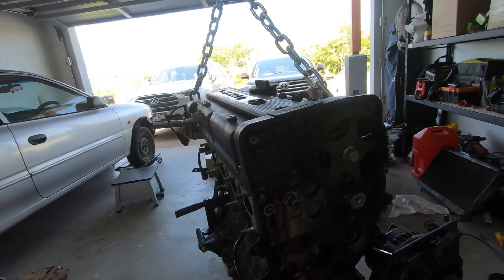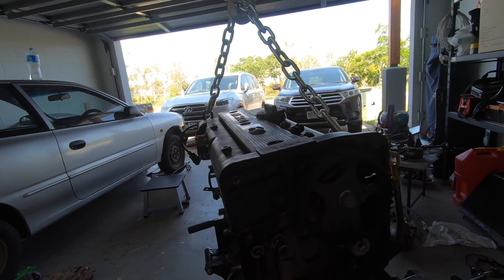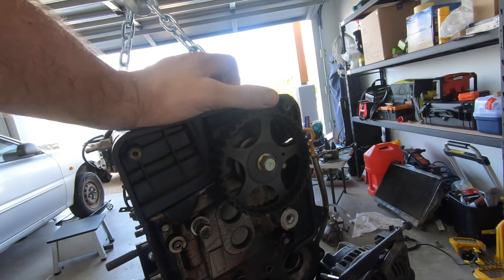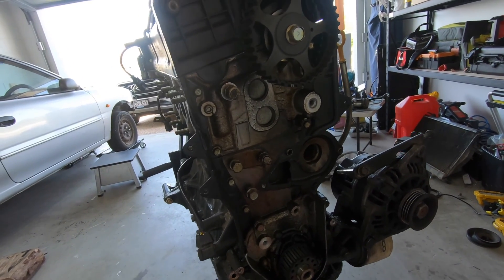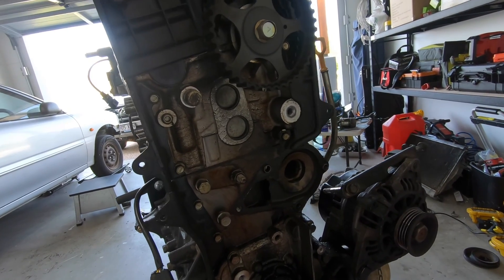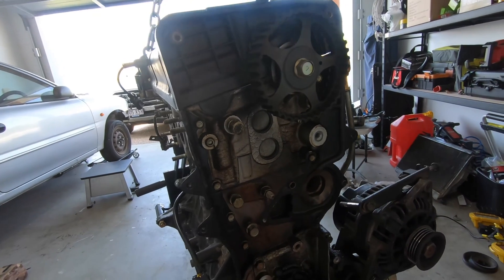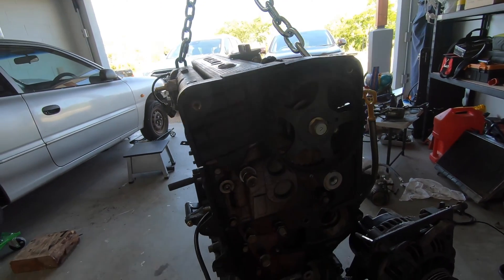I'm really hoping the head gasket comes so I can put it on, because I just figured out I have to take the whole timing belt off just to put the head gasket on. Right now I'm going to give this thing a bit of a tidy up, a nice bit of a clean, and I'll show you what it looks like after that.